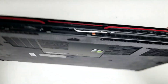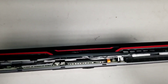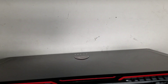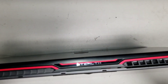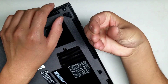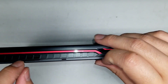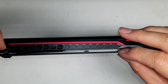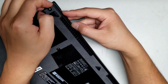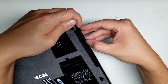Now that you've got both sides out, the back hinge cover will flip forward and come out. When you put this back, you have to put this side in first again, then rotate it. There are little hooks here, so get those in first and then put this down. On the very edge there's a little cup part that grabs into the mechanism. This part has little notches in it, and this side grabs it differently. Make sure when you put it down that you get that side in first, into the slot. While you're holding this piece inward to keep it in the slot, you can slowly pull these out and push the cover in.